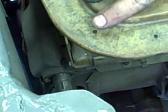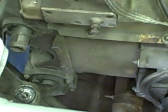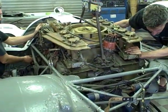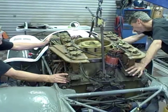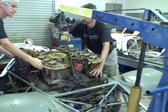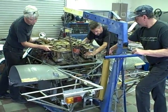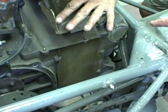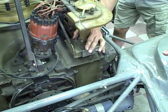You can see this drive over here — that's for the second alternator for Le Mans. The car would need it now, but that little extension up the camshaft is for the Le Mans alternator. You can see the motor's coming up slowly. When we take the motor out, we're not worried about it scratching this paint. The paint you see is gray, but it would be black — when it left the factory, the chassis was painted black and the fenders would have been gray. We'll change the angle to get the front of it clear. You can see how close it is to the valve cover — it almost looks like it would never go inside there. It's a pretty tedious job.